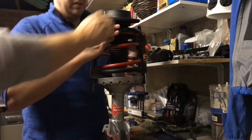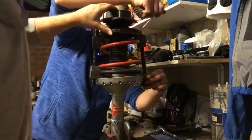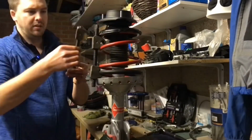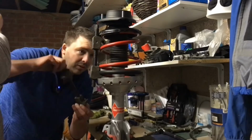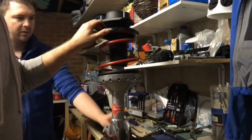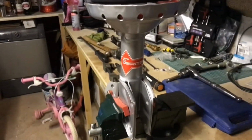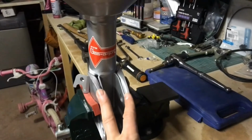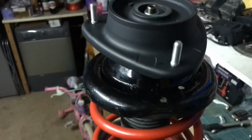And now, the game of getting them on. So on the 2 lower mounting brackets here on the strut, they are obviously going to sit outboard, and you need to make sure that your 3 holes here, 1, 2 and 3, are all facing outboard, and they all are, so that looks all pretty well lined up.